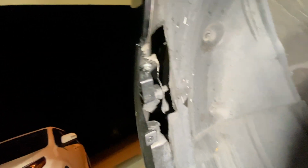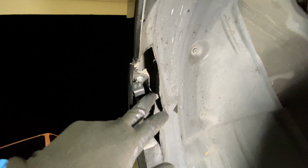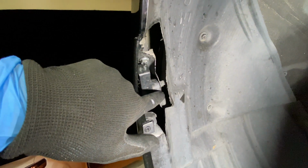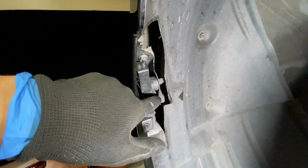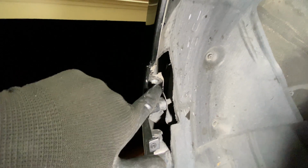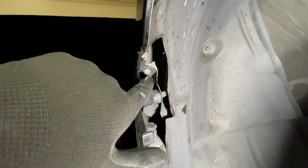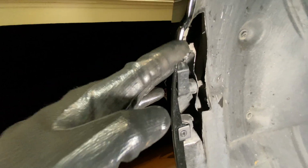I've trimmed away this thing, and it's been trimmed like this for years. When I first had the car, I had to trim these when I lowered the car. There's this part right here, you just take a grinder to it and shave it down as much as you can down to this plastic. And then recently I broke the little square right here that fits the OEM tab, so I basically relocated that bolt right there using a nut and a screw, and it's been holding pretty well.